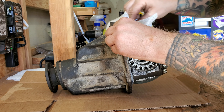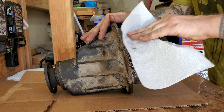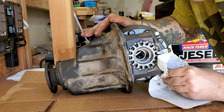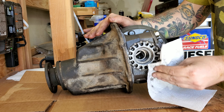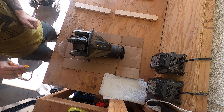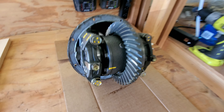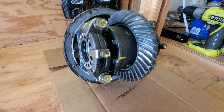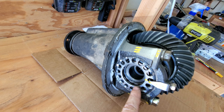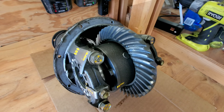So the first thing I'm going to do is clean off the parts just a little bit because I'm going to need to mark them. I think it's more of an OCD thing — I just foresee myself getting everything mixed up. So I'm going to put a few marks on everything so I know which side it goes on and what it's aligned with. Here's what I did — it's a little bit overkill but we'll see how it works out. I've got a mark here to line up the ring gear to the carrier cover, and each of these bolts is numbered one through four dots. I've got the alignment mark — I think this is going to be really important later on — and then the same thing, just one through four all the way around. Probably overkill but it's not going to hurt.